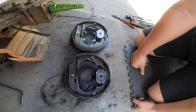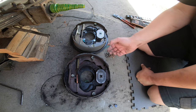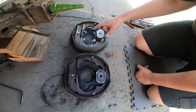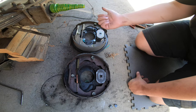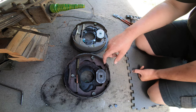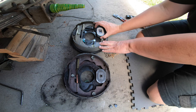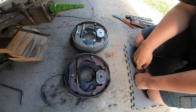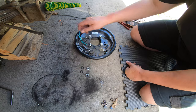72 hours later. It's a couple of days later — we managed to procure some new ones. The trailer joint we got these from said the drums are probably okay. These are almost worn down — you can see there's a wear indicator. These come in left and right directions; the main indicator is the direction these should face — forwards to the direction of travel. The main difference I noticed: this bit is loose on the old one but sprung on the new one, so it's definitely pushing against the brake springs. The old ones used lock washers; these new ones use spring washers, which I think are probably better for the application given the heat.